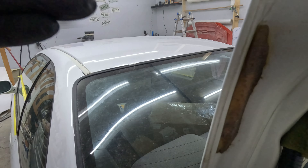And that's how you end up with something like this. Once it starts, it does not stop — moisture gets in there, it freezes, it rusts, and it creates all kinds of problems. So the first step is we need to grind it out. Let's see what's on the inside of the trunk first. On the inside it looks like some fiberglass they used — they were on the right track. This is probably several years old and it works, but it's not the ideal way compared to welding.